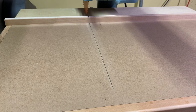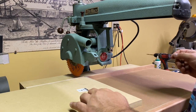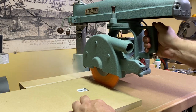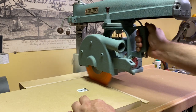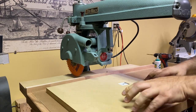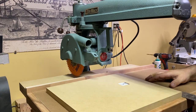With the cut into the sacrificial table, you can see the kerf, which will function as a guide for where future cuts will be made. Now we're going to do our first test cut and see how square the cut actually is. And that is very square — I think it's dialed in very well.